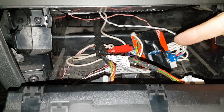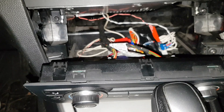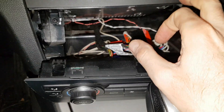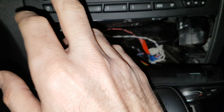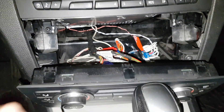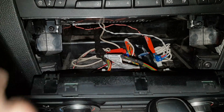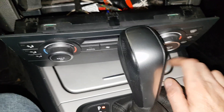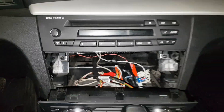One thing I still want to change: the system is still powered after the car is off, with the classical 30–45 minute delay before it cuts power via the 30-amp relay. I'm thinking of using the auxiliary pilot output and making a simple solid-state circuit — a small FET driven by that pilot output — to power the Bluetooth module. As soon as you turn off the radio, the Bluetooth module will be killed. Before, I was using the cigarette lighter power, which only works when the engine is running or when you hit start without stopping it. I think this approach is better.